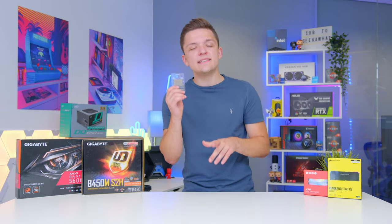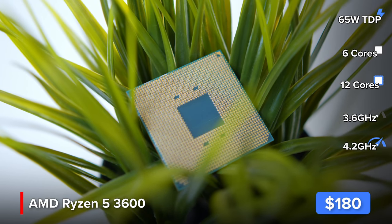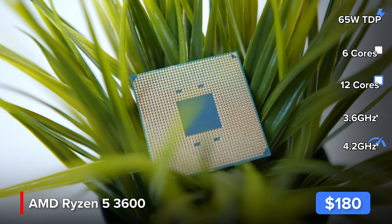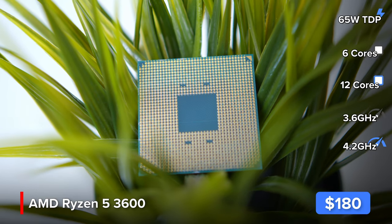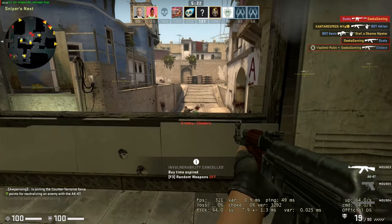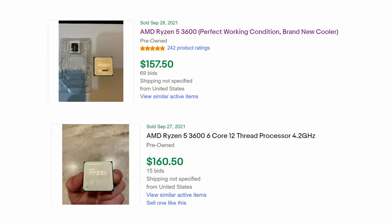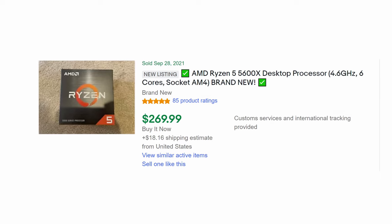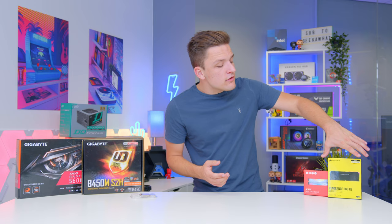It's not all about the GPU though — it's also really important to pick up a good CPU, and that's where AMD's Ryzen 5 3600 comes in. I'm calling on last-gen tech to make this build possible for a few reasons: six cores, 12 threads, good overclocking support, and solid single-threaded and multi-threaded performance make it a great all-rounder. Plus it is way cheaper even brand new than the 5600X, the CPU that sort of replaced but not replaced the 3600.